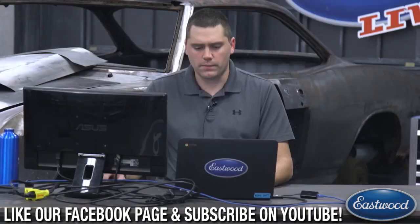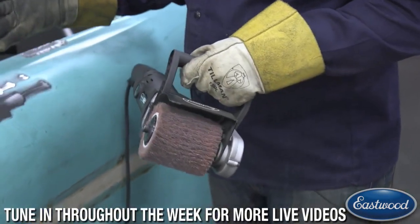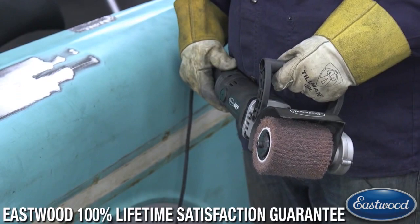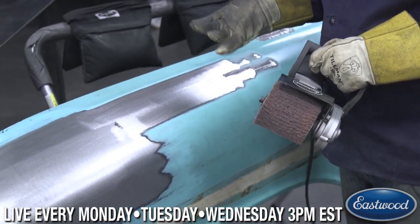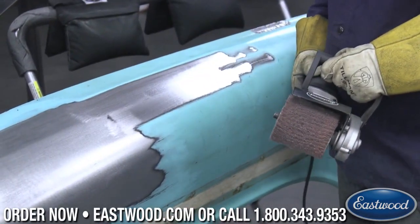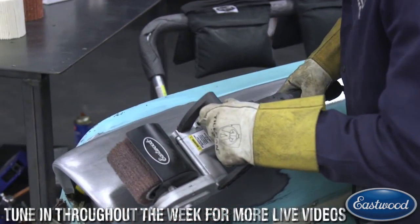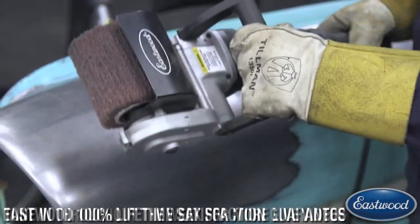Very industrial-style build. With the size of the motor on this, this isn't a small tool meant for home improvement situations — it's made industrial to use with the automotive world in mind. We're not trying to sell you something that was made for another purpose. When we came out with this tool, the idea was we wanted guys to hammer on it, and that's why a lot of professional shops are shouting about how much time it's saving them. We have a lot of guys that buy this tool and love this red drum for metal-finishing panels. What it does is save you the time with a DA and Scotch-Brite — if you're trying to get beautiful metal finish work with basically no filler, this takes forever with a DA. With this, you just run over and it's ready for primer because you're putting some tooth in the metal — strip and get it all ready in one shot. And it makes your Instagram photos look great.